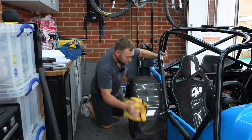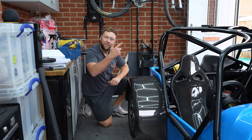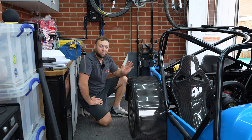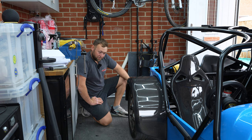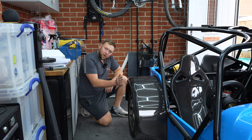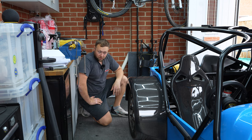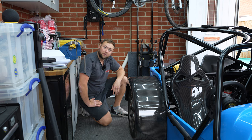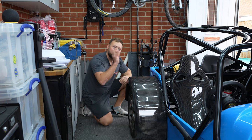It's not a bad job. Trying to get it symmetrical both sides - we had a little panic because I was like, oh no, we're off. I measured the other side - exactly the same, maybe like two mil out. Two mil between friends. I'm sure this car got built from the factory with more than a two mil tolerance. But it looks really nice - the wheel is centred in the arch. Now we just need some better fitted wheels to fit the arch. We're going to pop the wheels off and try and work out the camber to make sure we're level. The carbon and the blue - oh yeah, beautiful, perfection.